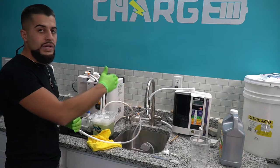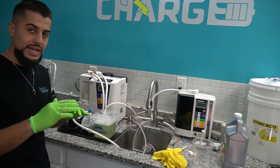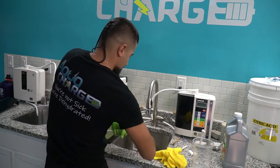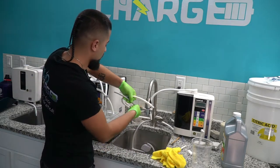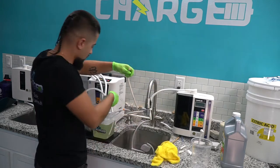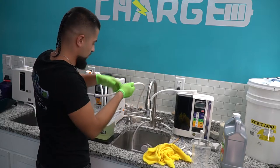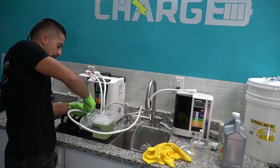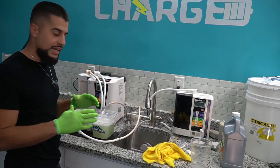After it's cycled for an hour, we're going to do the same thing for the other hose — this is the last step. Stop your pump, turn off the valve, open the door, and unhook the quick connect. Put the quick connect inside and do the same thing for the other line. Dry things out, take off the other piece, dry the quick connect, and connect it to the other side. Close the door, turn on your pump and valve, and let it cycle for about an hour. I'll see you in the last step to show you how to put everything back together.